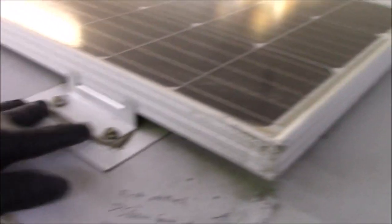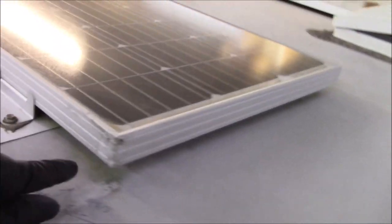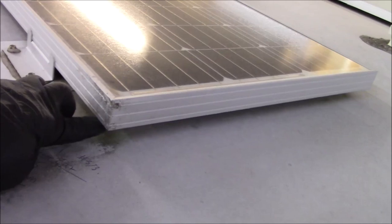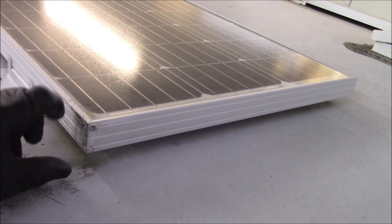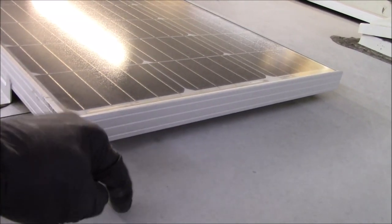So we'll end up elevating this and we'll get the solar off of here. This is not recommended at all. Even though they give you these brackets, this is not a good mix. Right here, screwing it right to the roof. That's one. The other thing is, you need to keep this elevated at least 2.5 inches off the roof deck, because if you don't, that panel gets real hot and it will degrade this roof system.